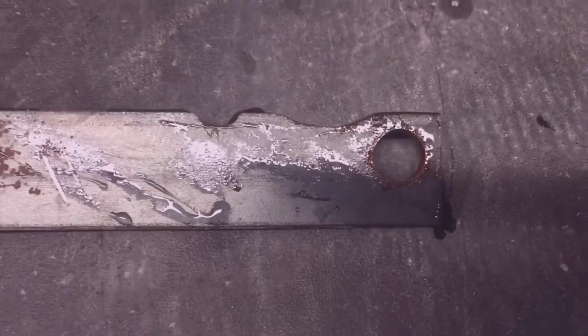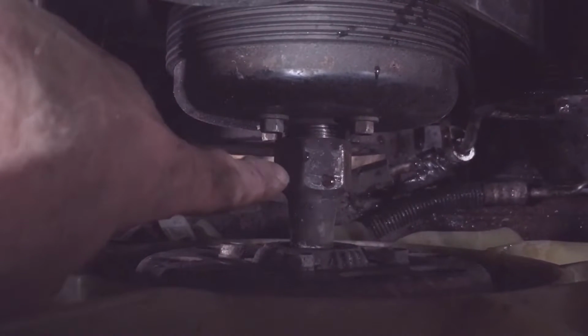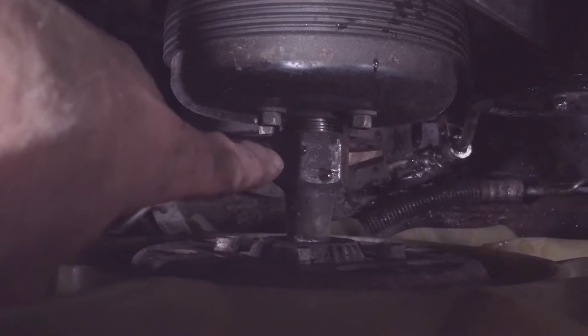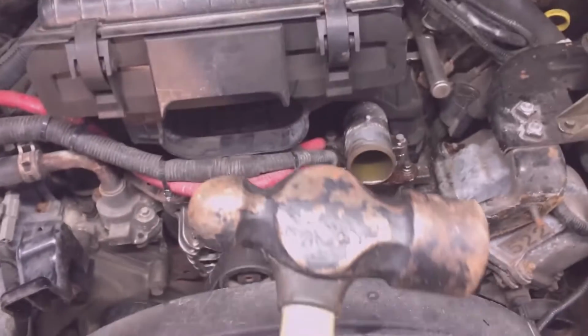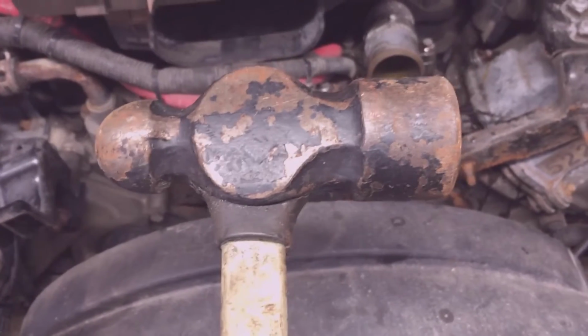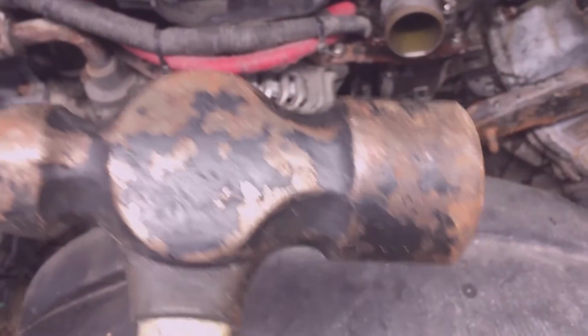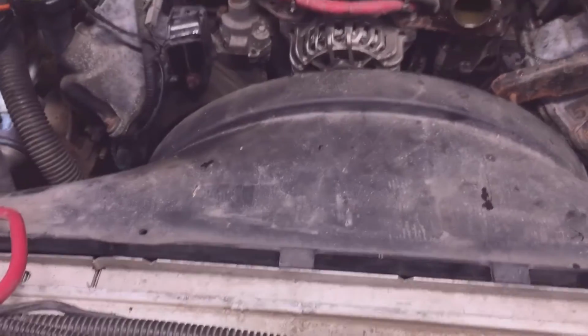And you can see, I guess it didn't take the abuse too bad. So that holds the nuts of the water pump while you turn the hex nut of the clutch fan, and use that big crescent wrench and hit it with a ball peen hammer to give it some shock to get it to break loose that first time. And then even if it's extremely rusty, it's fine threads. So once you break it loose, it comes off relatively easy. So that's my makeshift tool. Shouldn't need it putting it back on.